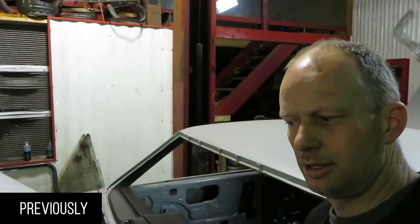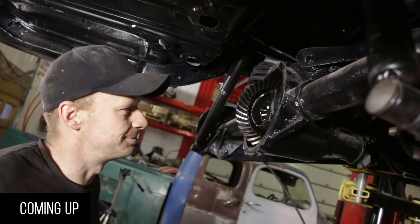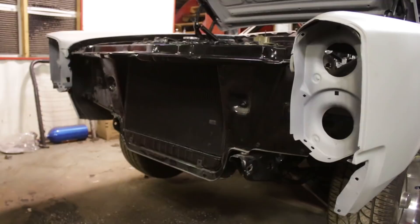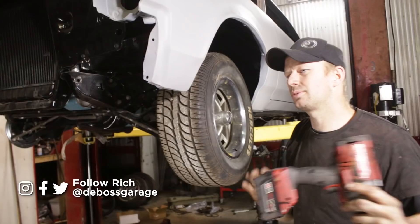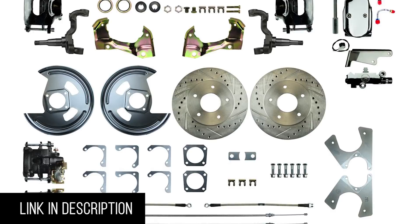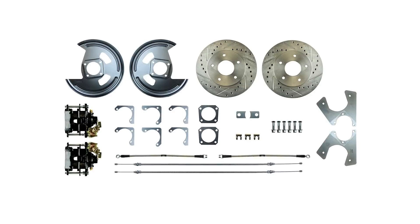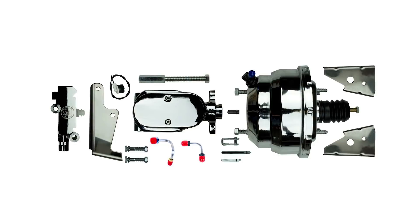Before we did this brake install, all 242 GTOs came with a posi — this does not have a posi, so we need a posi. Now our GTO is a true 242, so it already had disc brakes in the front, but it still had drums in the back. The reason we're converting it is we needed a rebuild kit for the front and were having issues matching up the right seals. This kit gives you everything you need: the booster, the master, and brake lines for A-body GMs — your Chevelle, your GTO, your El Caminos. Head over to Summit to see what other kits they have for other makes and models. The installation will generally be the same, so you can follow this video as a reference.